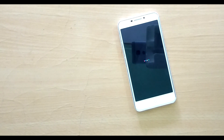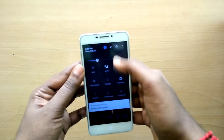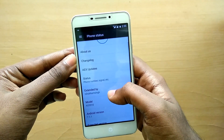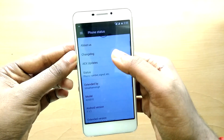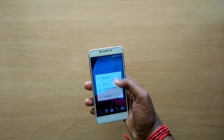In order to flash the custom ROM you need to have TWRP recovery version 3 or above. If you are using an older version or haven't already installed TWRP recovery, I will leave a link to the latest TWRP recovery in the description below. You also need to download two zip files — the ROM and the GApps zip files. Links for both will be in the description. Make sure that while downloading Google Apps, you download ARM64, the base version of Android 7.1 GApps, and make sure you download the Pico version.